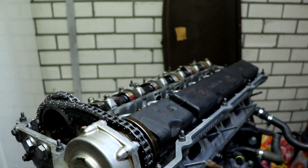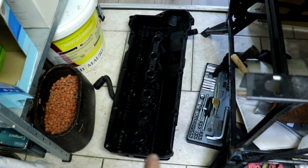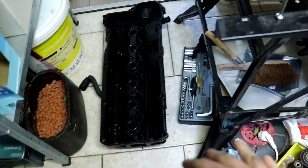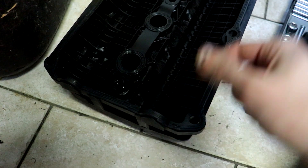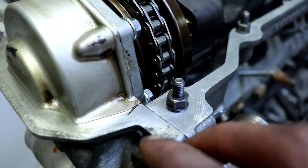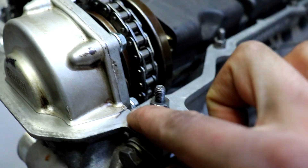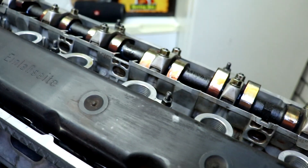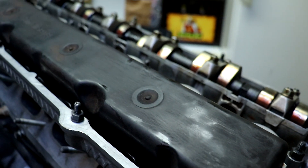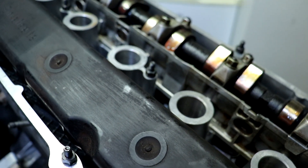We're working on the final touches now. This is the cover from my B25 engine - I like the plastic cover better. We're going to put a new gasket on, although this one is maybe 5,000 kilometers old - we're just going to change it anyway. Then we'll put some gasket maker around the edges, here at the edge and at the halves here. Then we can put the cover on, tighten it down, let the gasket maker dry, and then put the spark plugs in.